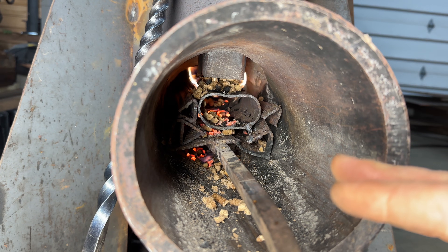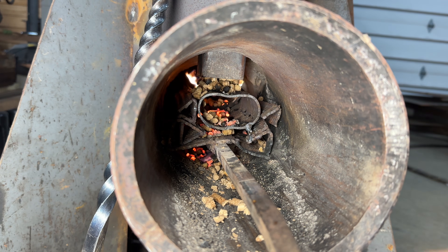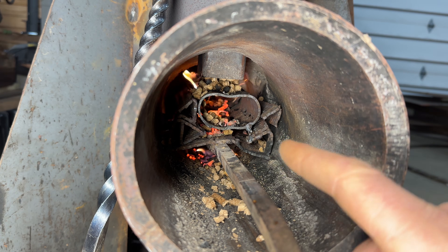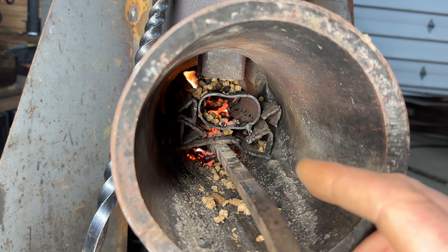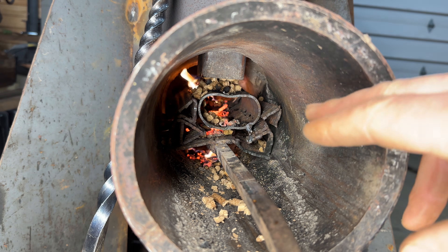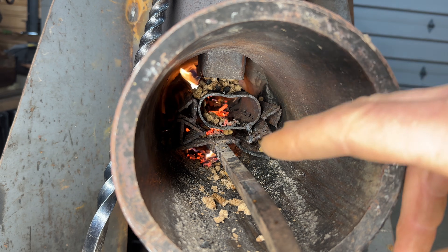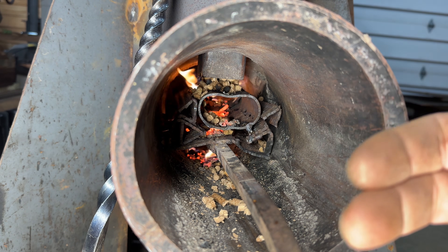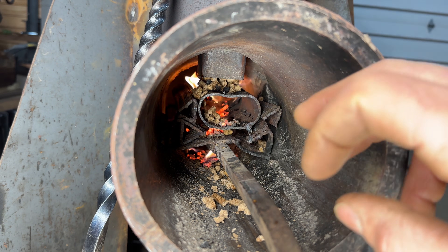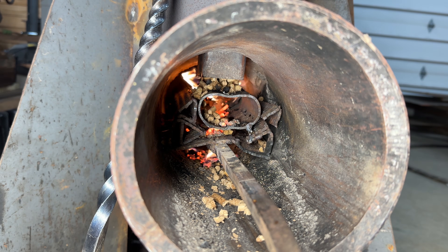Before I do that — I'm just about out of pellets. So I'm going to show you where the pellets go and how I get away with loading more pellets than it can take so you won't have to mess with it. If you can get two bags in your pellet heater, you don't have to mess with it all day on a semi-cold day. I call this idling — the stove's idling, putting off maybe 150 degrees. What we're going to want to do is add some fuel. When you add fuel it's going to put your fire out — the only thing burning is just right here. So when we add, it might choke it out. Instead of letting the fire try to crawl back to the pellets, go ahead and light it again. You want enough fuel in the front to keep everything going.